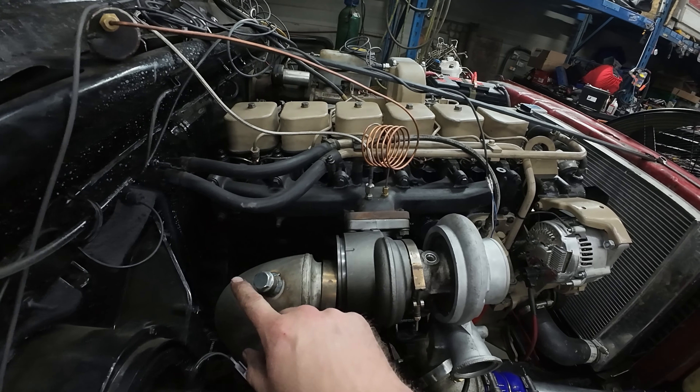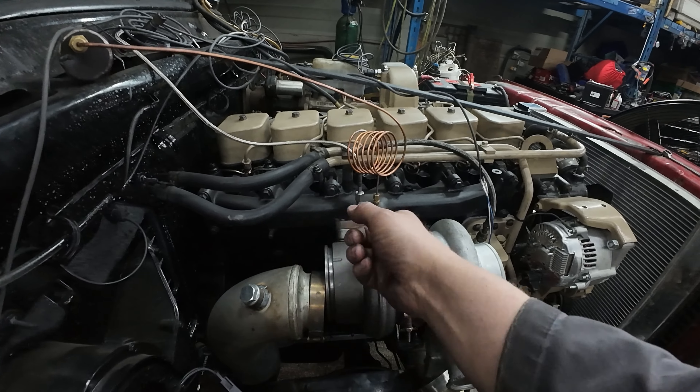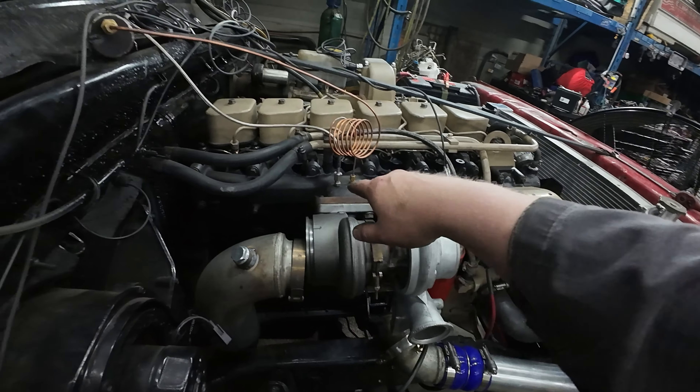You can run the probe either location, but the big thing is you have to know what the difference is going to be. If you put a probe here, ran it here for a while, and then wanted to move it for whatever reason, you could do that — because then you know at full wide open throttle, buzzing down the highway pulling a trailer, how hot it's going to get. If the truck is tuned properly, maybe 1400 degrees. If it's running hotter than that, you want to know exactly — not guessing — because if you're guessing, you end up with pistons like that. Not what you want.